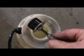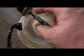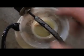It's well insulated. But anyways, we're going to go ahead and get some transmission fluid in this. This is the bug sprayer I use, and this is actually a thing I've made, which is an expandable freeze plug with a fitting. I drilled this completely through and brazed this piece of brake line in there and stuck it in there.